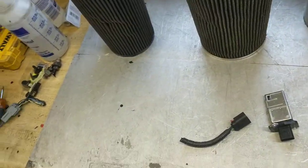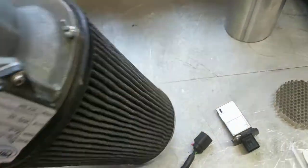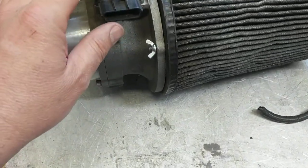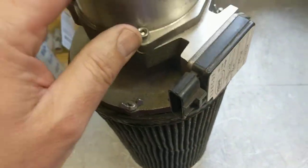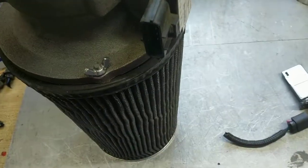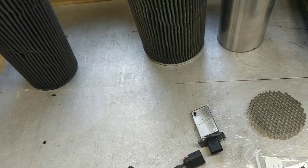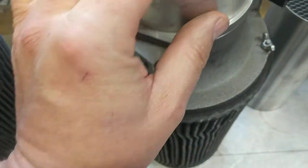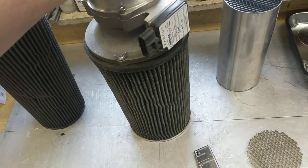What's up fellas, I want to share a little info about mass air meters. This is my favorite — the 92 millimeter Pro-M. This one's going on my 88 GT with a 347 eventually. These have always been my favorites because they make a lot of power and because they're 92 millimeter, you don't have to worry about running out of meter size. I've run these on stock 302s, warmed-up 302s, 306s, and I've got one on my LTD LX with a 331.